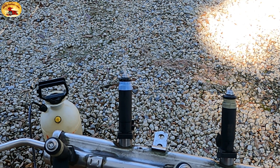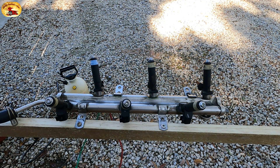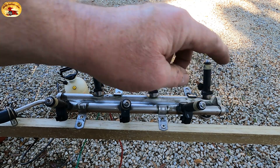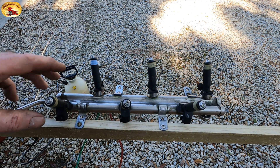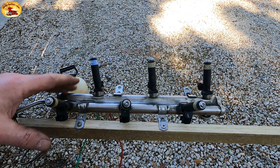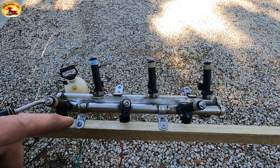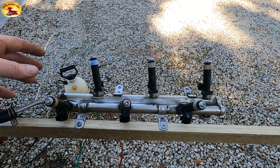I can show you how I did this build in the next video if you want to know how to do it — let me know. This is how you clean them, very simple. We used the fuel rail, pushed every injector back in — they're all clogged, shooting streams that are not even close. We have a really unique way to get the cleaning solution through it, and we have a special mix. You run it through and let it set for a day in the injectors in the fuel rail.